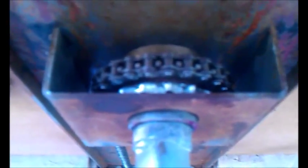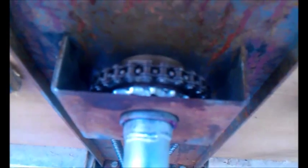Well, the lift is successfully repaired. I degreased the chain and actually lubed it up with a chain lube instead of whatever multi-purpose lube was put on it that destroyed this lift system. I carefully put the gear system back together and pounded the pins back in.